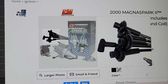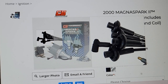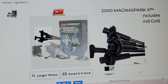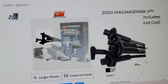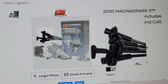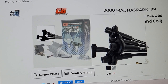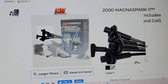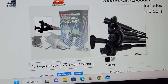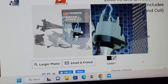One of the things you need to know if you're going to do this: this is a high energy ignition type system where you have a much higher voltage — your spark goes further, it's like the newer cars. The newest cars all have coil packs, which is even more efficient than this. This is like late 70s, early 80s technology, which is a whole lot better than the 60s and 50s technology that VWs had.